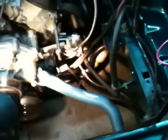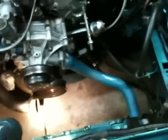I did have to remove, let me show you down here. I'll grab the light again. I did have to remove that downpipe that connects to this header pipe right here because of that sway bar down there. That comes over and connects into that pipe right there. Still got to put that back in. I couldn't tell when it was out, but should have realized it has to go under the sway bar and then back over. So I disconnected that.